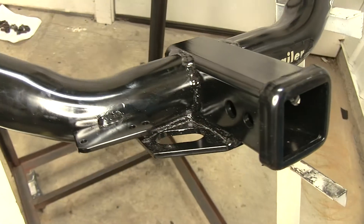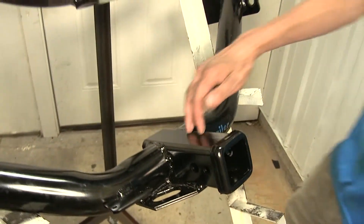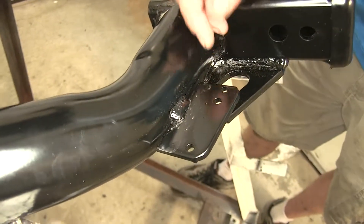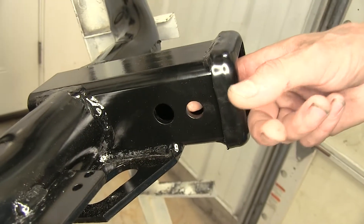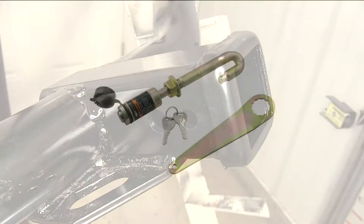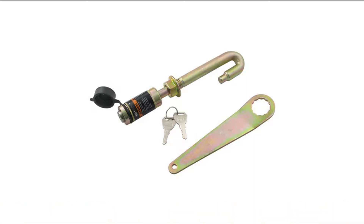The main difference between our two hitches here today is that our DrawTite has this extra tab welded onto it where you can mount your electrical connections for your trailer wiring, such as your four-pole flat or your seven-way RV connection. Our DrawTite hitch also has an additional hole in front of the standard 5/8-inch diameter hitch pin hole. This hole is for your J-Pin stabilization device, which you can use to help take some of that annoying shake, play, and rattle out of the device inserted into your receiver.